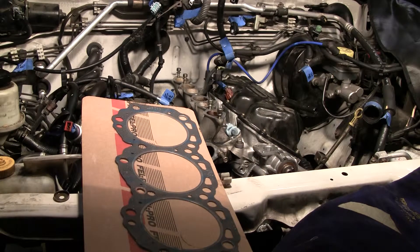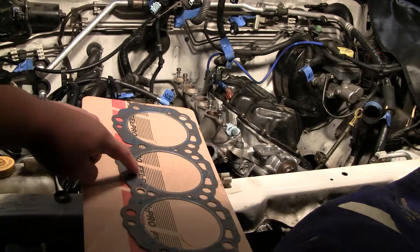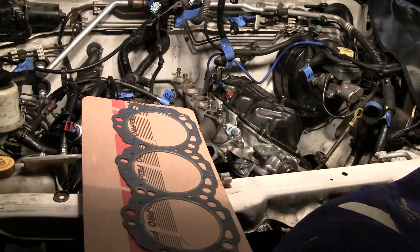When you're being very meticulous about your builds, you've got to be really mindful of all the small details. That little scratch on the inner combustion ring could mean hours upon hours of extra work. You could be wondering why you have no compression in that cylinder, why your engine runs like shit, or why you have milky oil — all because of that one little scratch on the head gasket.